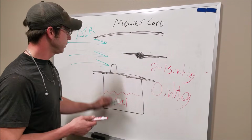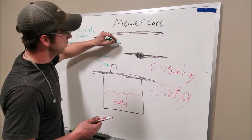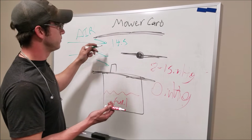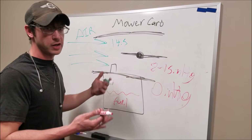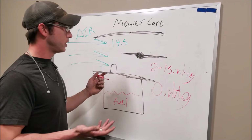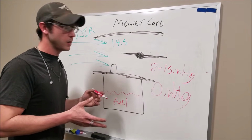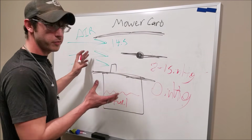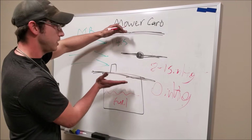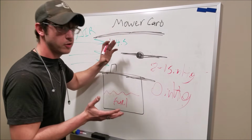So that changes the relationship of the design of what the jet was originally for. And since our airflow, this is a naturally aspirated engine, atmospheric pressure is 14.5, 14.7 PSI, depending on where you are with the sea level and whatnot. In Iowa here, around 14.5 or so. So basically airflow is limited by the size of the carburetor itself, okay? We can only get so much in.